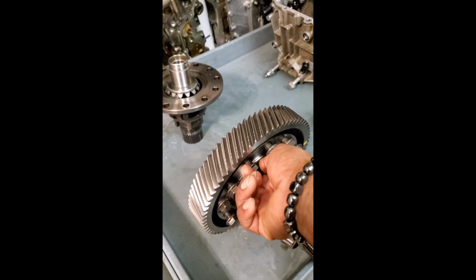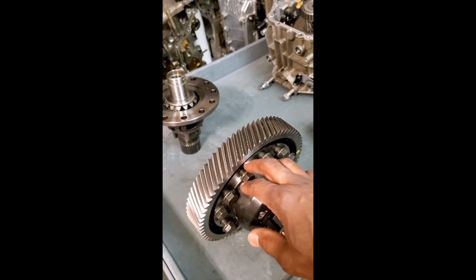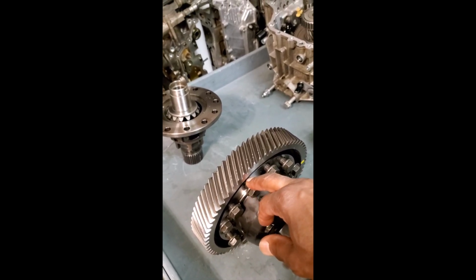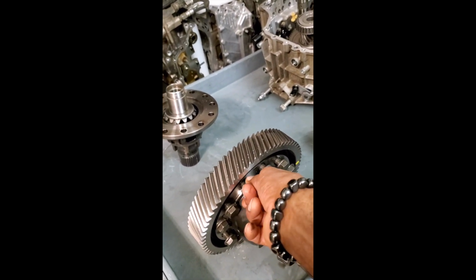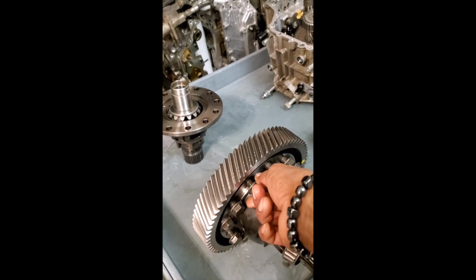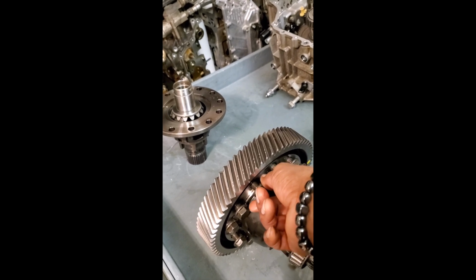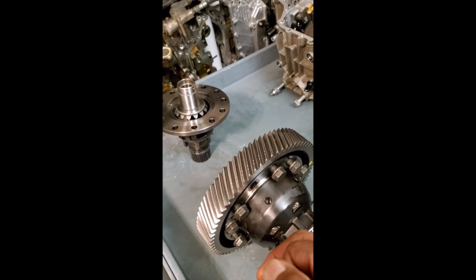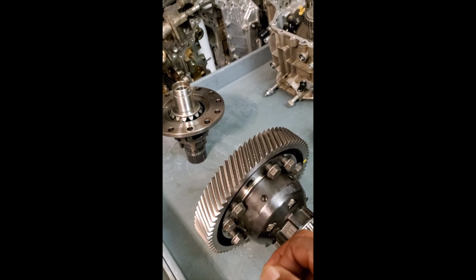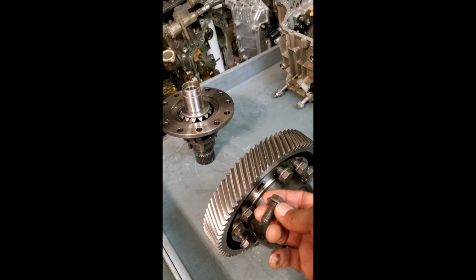A lot of cars, we don't have much information with cars, or there's not much on the internet with a lot of the Volkswagen and Audi cars with transverse engines and a Wavetrac and launching really hard with 1300 horsepower and above, if they've ever had any type of problems with these bolts coming loose. Anytime you're exceeding 1,000 horsepower, a lot of times I've found in many applications they're using Loctite on the bolts. Under the factory torque specs and under normal factory horsepower, you're not going to be causing a lot of shock to where these bolts will back out.